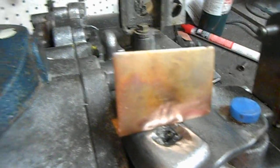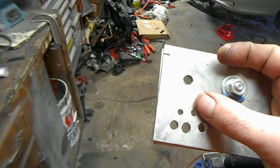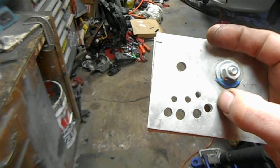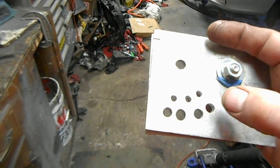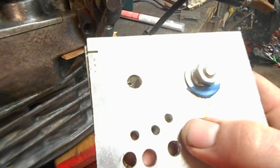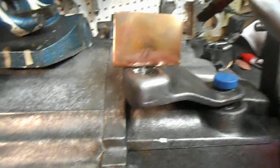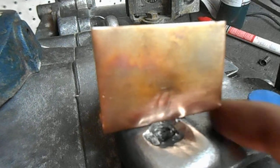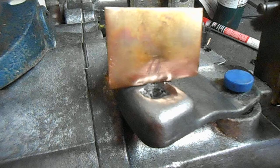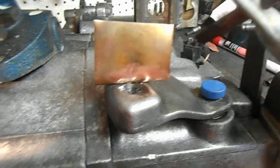This is what I'm working on this evening. I've got a hole in the metal right there. What happened was, when I was making this shift plate, I drilled these holes in the shift plate and then drilled a hole in the shifter, then drilled a second one. The first time I drilled the second one it lined up, but when I went to tap that hole on this part of the shifter, I broke the tap, so I drilled a second hole and had to make these larger so it would line up. When I tried to tap that second hole, I used an older worn tap and it just snapped. Then I had two taps broken off in this part of the shifter, and I tried to drill them out — using cutting wheels and carbide bits and drill bits — and it was a mess. I got out as much of the tap as I can.